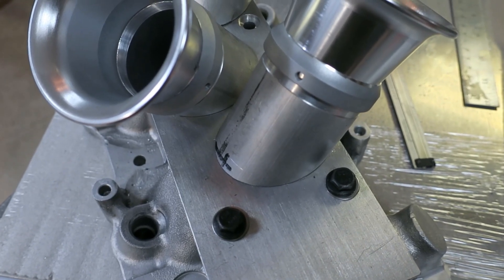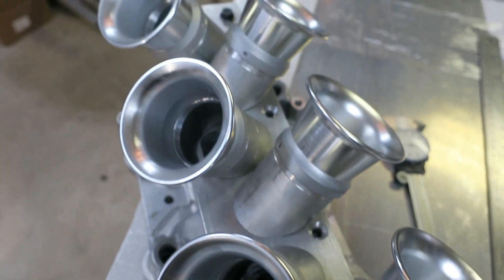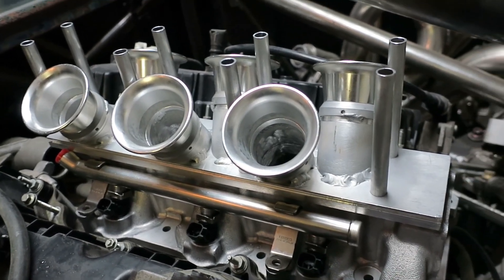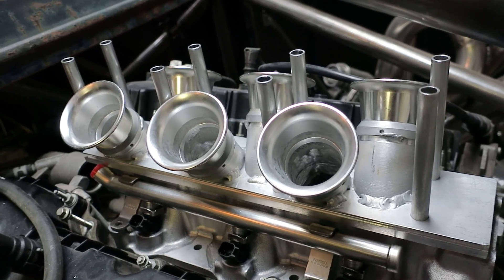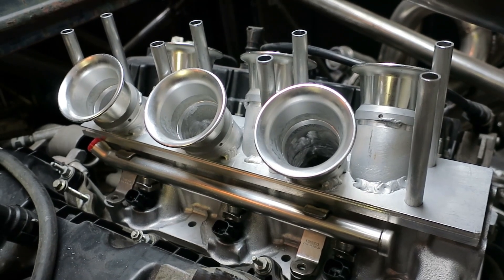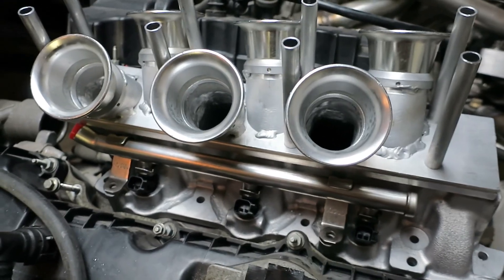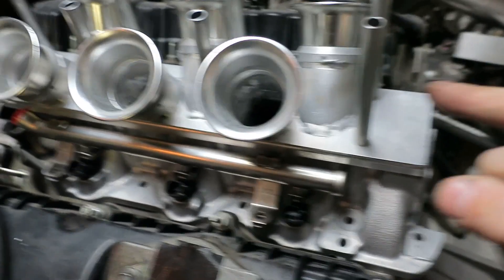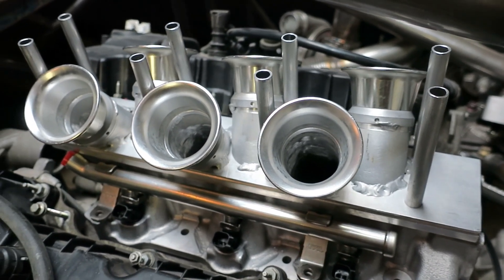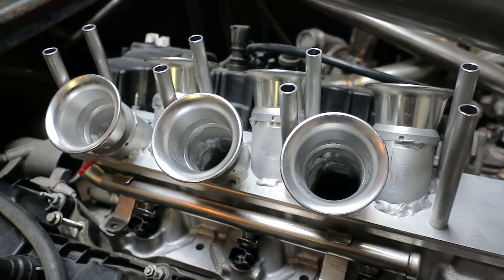These runners don't need to be welded all the way around. I'll just put a couple of good solid welds on, but the whole area is going to be pressurized so it's not going to be a problem if there's any leakage there. I've got the runners welded to the base plate. It's a shame all this is going to be enclosed inside the plenum because I kind of like the looks of the stacks. It's always a challenge when joining two pieces of aluminum that are dissimilar in thickness — the tubes on the runners are eighth-wall and the base plate's half-inch, but the welds turned out okay. All these vertical tubes are for bolting the plenum down to the upper manifold and also give some structure to the plenum to keep it from deforming under pressure.